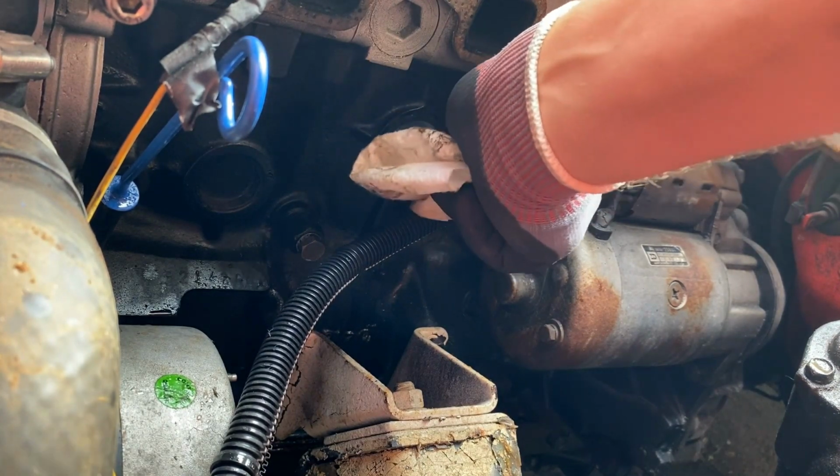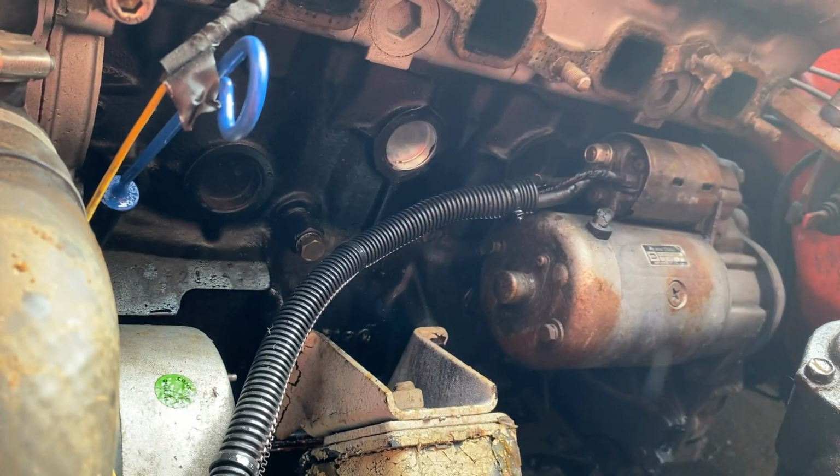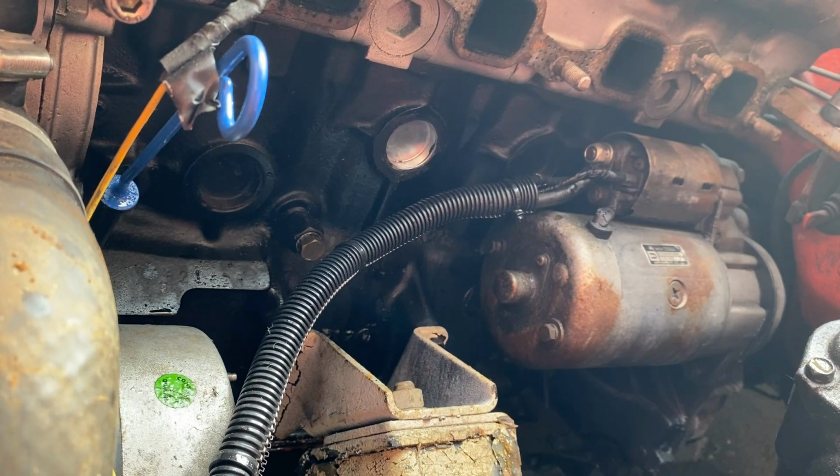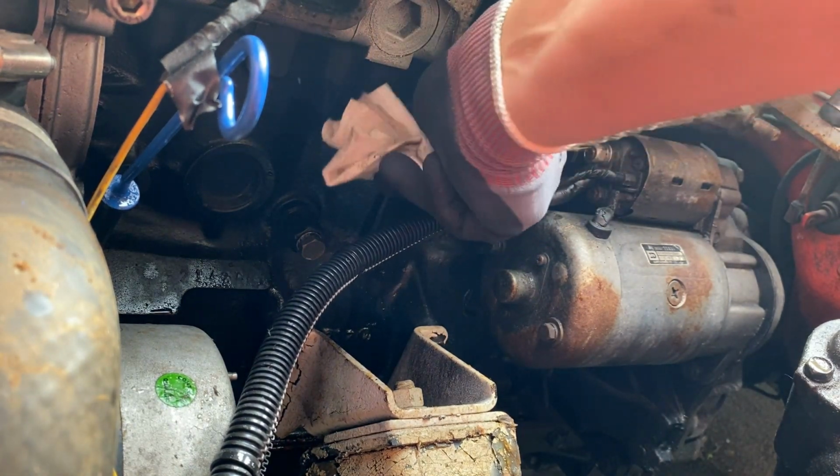Make sure you remove all the remaining gasket and then tap the plug gently into place. Always try to get it as straight as possible. Do a little at a time and only just flush with the tapered hole.